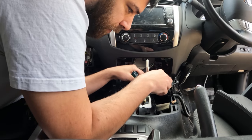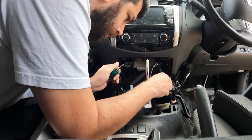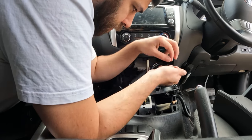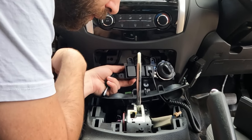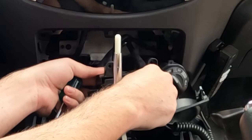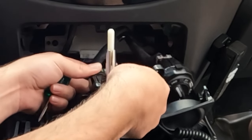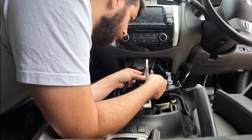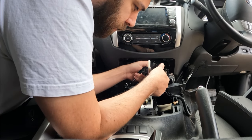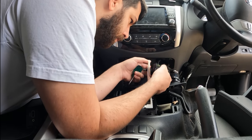What I'm doing now is just unscrewing the panel that holds the switches in, making sure I don't lose the screws. Now we've got the switchboard. I've already got a UHF one in that slot there and I've done a slight dodgy one where I've just gone straight through the switch and gutted out the connection piece just because of the type of UHF I bought. Pretty much we want to disconnect this switch from the back — the diff lock one — it's not going to be doing anything now.